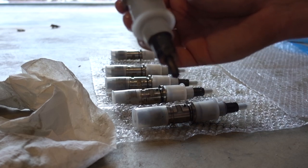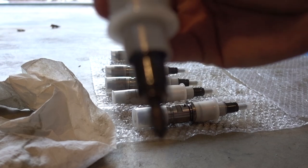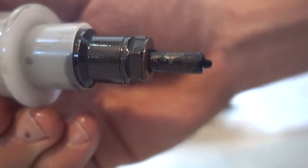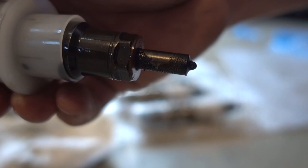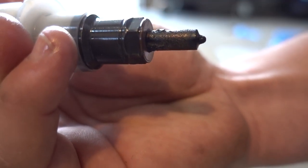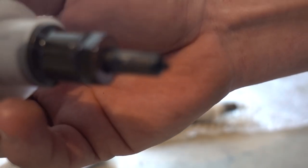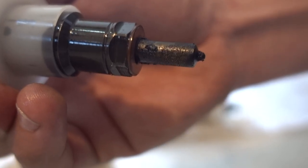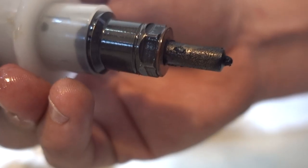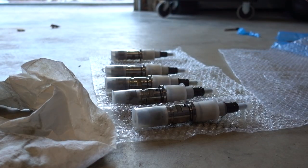I can't remember if I showed it in the install video, but you can see — there's all kinds of crud and crap on these injector tips, and that's normal. That's nothing to be really worried about, but what you do want to do, especially before you put your new injectors in, I have this attachment for my vacuum that I use to stick down in the injector bore, really to make sure anything down inside the cylinder head is completely clean before you push your new injector down in there.